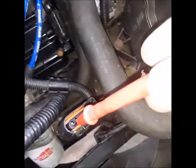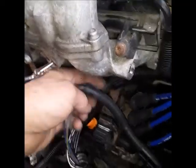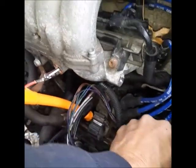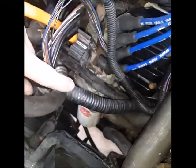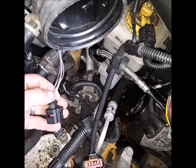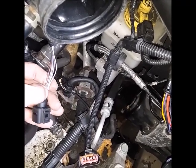I unwrapped all these wires to the coil because they were really bulky and I thought maybe they had been spliced back together, but no — it was just a big water tape wrap. I don't see that wire going back up unless possibly in here it splices off. I've got a purple and black, a solid purple, a purple and white, a white, a brown and yellow — and this is for the throttle body up here.